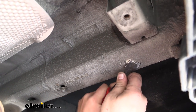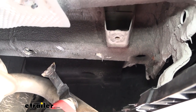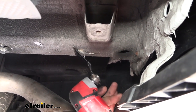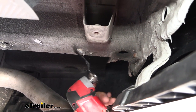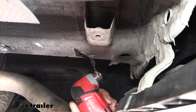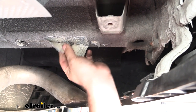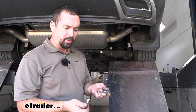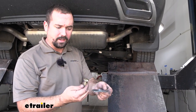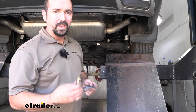If you're using a razor blade or something along those lines, just be extra careful. If this is putting up a pretty good fight, an oscillating tool or multi-tool is really nice here — just make sure you don't go at a straight angle against the metal, but you can really dig under the undercoating. At this point we're going to use a fish wire technique to get our carriage bolts and spacer blocks in place, creating the stud for our hitch to mount up to. If you've never done this it can look a little tricky, but it's pretty simple.